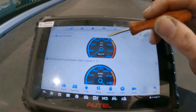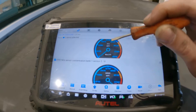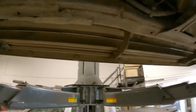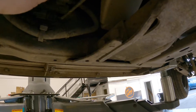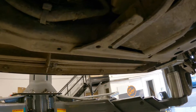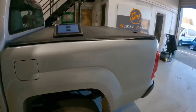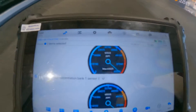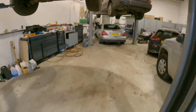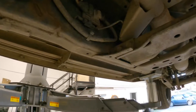Just to confirm, I'll unplug the first one and check that the reading does stop. And yeah, it's gone to the default value on the first one as well. So we can safely say that the second one is at fault. I'll plug the first one back in.